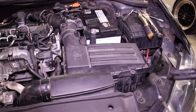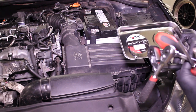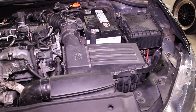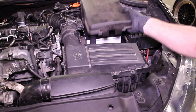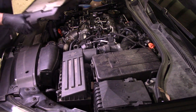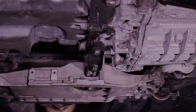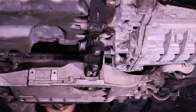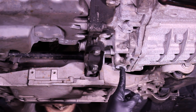We are done on the top side. Gather all tools, put the car up on the air, and drain and fill the fluid. This customer did have a battery box cover, and we want to make sure we don't forget to put the engine cover back on. Here we are underneath the vehicle. We're going to go ahead and drain the fluid. This is the drain plug right here, just next to the dog mount bolt on this vehicle.